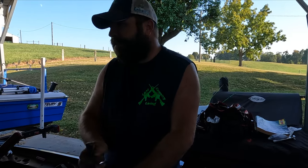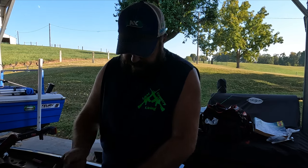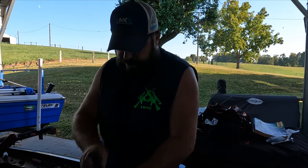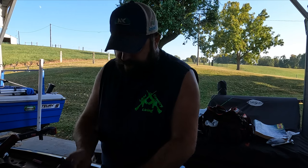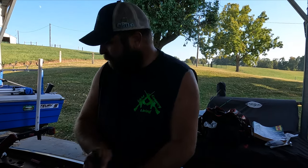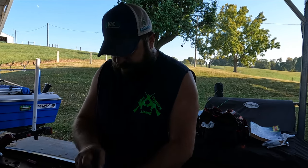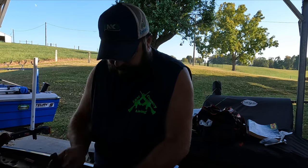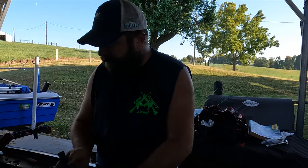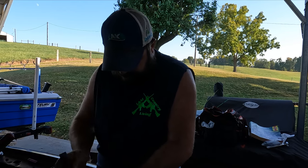It's got one electric, which kicks on mainly when the air conditioner's on and when it gets really hot. And then it's got a clutch fan on this side. And put the plug back in, put antifreeze back in it, hook it all up, and start it up, and burp it. Burp. That's about it.